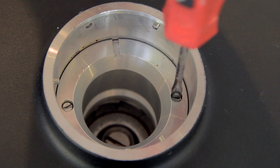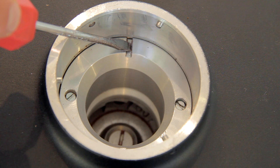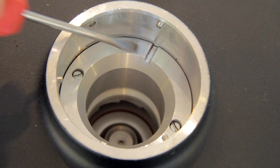Now to calibrate, you're gonna loosen these two set screws. You don't need to take them all the way out, just a little bit so that the carrier will move. Once you've loosened them up, you're gonna wedge your screwdriver in the burr carrier like this, turn your grinder on, and slowly rotate the burr set clockwise until you hear it chirp.